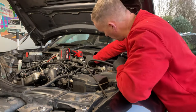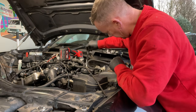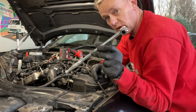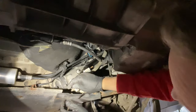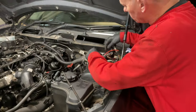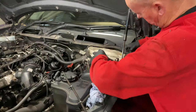Just a few finishing touches — I feel like we've really made a big step now. This last bell housing bolt at the top is really a nightmare to get to. I've used a knuckle bar with a single socket — you just have to work it up gently and eventually you get there. You can't get a ratchet in, it's just too fat. Down underneath, we've got the earth strap to go on — 13mm nut, don't drop it. Make sure that's up nice and tight, then finish off with the loom, plugging it back into the fuse box. The connectors will only go on one way, just route your wires neatly and get the lid back on to keep it watertight.